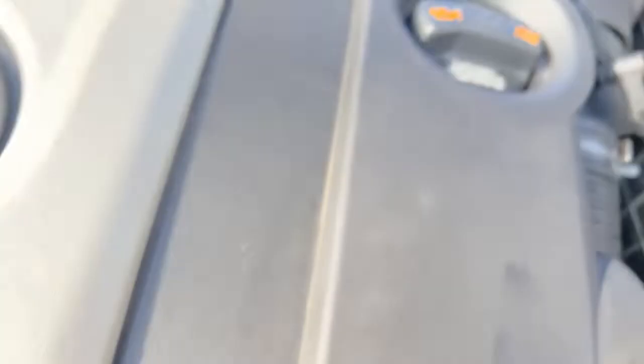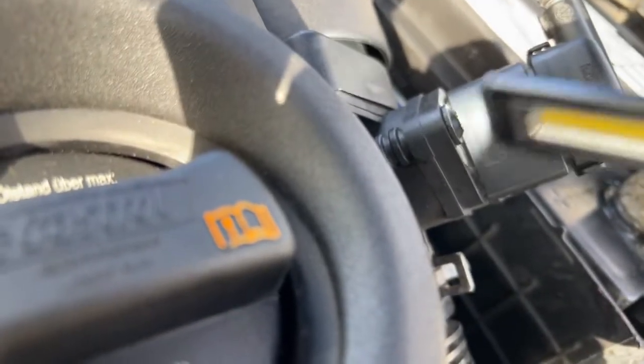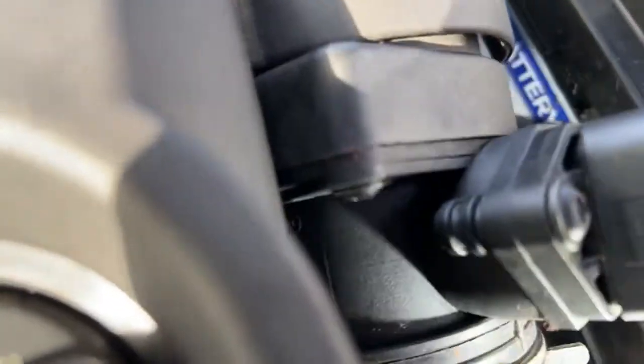See if you guys can see what I'm looking at — there's one down there. It'll be tight; you may have to take it off. It's one gasket — you need to clean it. I didn't mess with taking these guys off because they're a strange setup and I don't like to remove mass airflow sensors — if you do, you can damage them. So be gentle. There's a strange little nipple fitting there — it's like an inverted nipple the way it's set up.